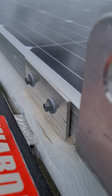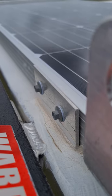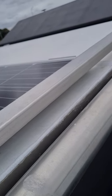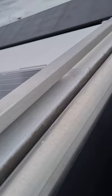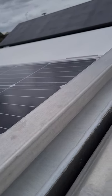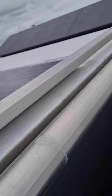All I've used is six pieces of aluminium angle with tech screws into the side of the panel, and that's SikaFlex to the top of the canopy. To reduce heat I also painted the top of the canopy white — you don't see it anyway, so who really cares. That's just outdoor solar house paint — etch primer then white paint over the top.